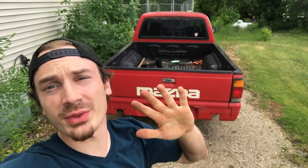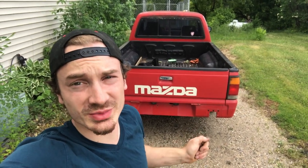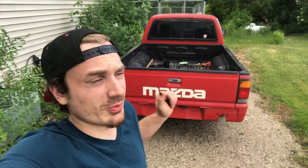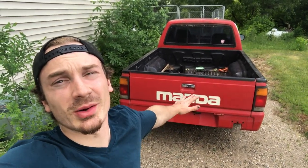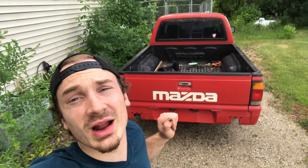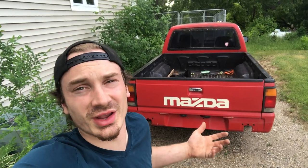The fifth and last thing I hate about my Mazda pickup is the automatic transmissions. Neither this one nor my other two are automatics. The very first Mazda pickup I had in high school was an automatic. These pickups, if you got one built on a good day, still had under a hundred horsepower. You pair that up with an awful slushbox automatic transmission and these things were dangerously slow — they can't get out of their own way. If you have a manual and can wind it out a little bit, not only is it more fun, but it kind of wakes the truck up. The B2200 was a 2.2-liter and the B2600 was a 2.6, so the B2000 is the smallest engine they offered. One thing I like about the B2000 is the valves are adjustable — kind of like on Hondas, there's a little nut on top and you can do a valve adjustment pretty easily, unlike the 2.2 which has a fixed valve train.